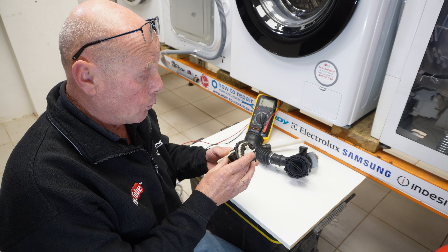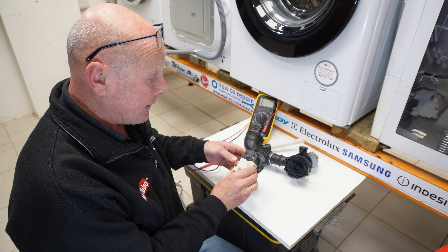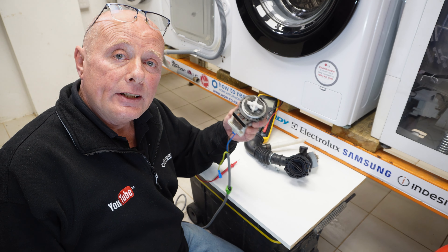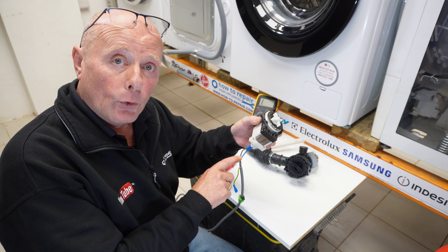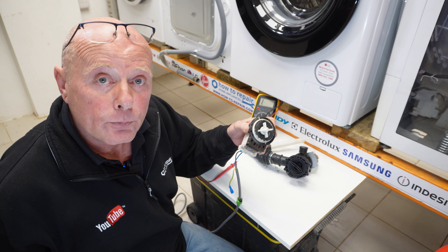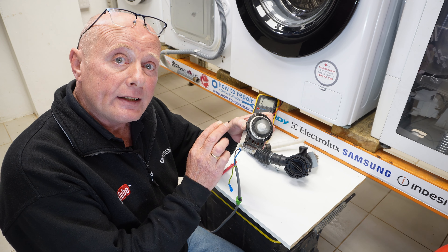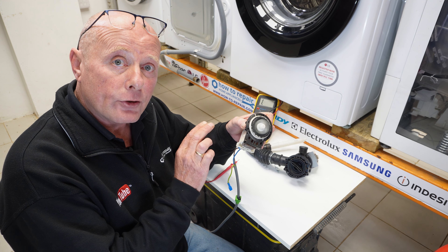You need to understand how the pump works and rotates. You have an armature inside and you also have field windings. You are only able to test the field windings with a multimeter to make sure they are good. AC and DC pumps can be tested with the correct power supply. I've made a hot wire lead for this and it's an AC pump — you should only do this if you're competent with electrics. Turning the power onto the pump, you can see that the impeller turns freely. You will get a little bit of vibration off the pump because it is an AC pump with a magnetic field that turns the armature. The DC pumps are much quieter and smoother.